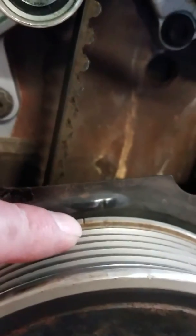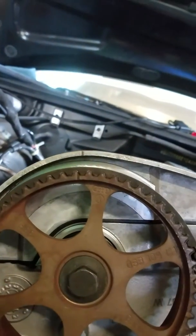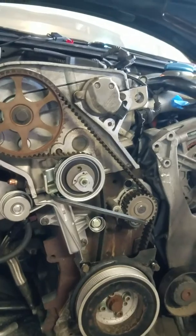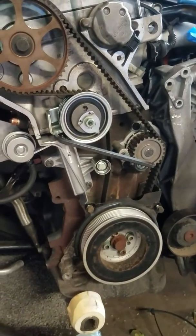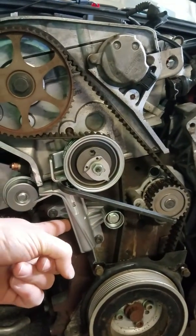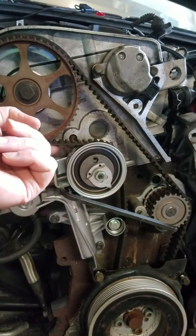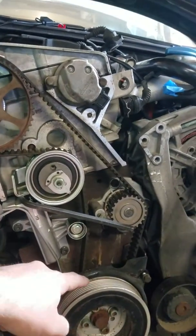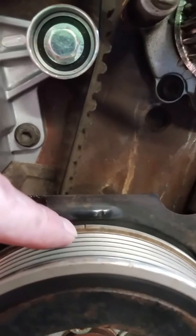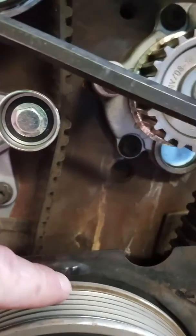I've already run this motor. You can see right now it's sitting back slightly — that's where it's resting, a little bit counterclockwise of the timing marks up top. It looks pretty lined up but it's actually just a hair off counterclockwise. I have turned over the motor a few times to double check this before I pull the pin on the tensioner, and every time I rotate it around two cranks, it lines up dead perfect top dead center on both the cam sprocket and on the crank sprocket once it's in tension and I'm moving it with a wrench. Those are the tips: install the tensioner last, get the belt on first, use your finger to rotate the lever up. You can easily line up the belt as long as the crank sprocket indication is just a little bit — three-eighths to a half inch — counterclockwise of the actual mark on the cover.